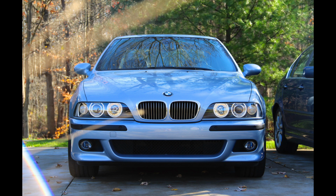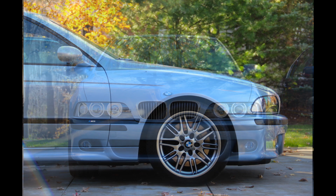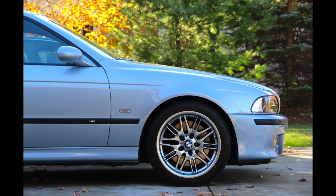He fixed the leak very quickly and went to put the transmission back in, and the pressure plate needs to be reset. The E39 M5 stock system uses a self-adjusting clutch, and the pressure plate needed to be reset. There's a specific tool for that. BMW dealers are supposed to have this tool. It's something like an $1,800 tool, so I can't go on Amazon and buy it. And none of the five or six local Ohio BMW dealers were able to get their act together enough to locate this tool. One thought they had it, but would not lend it out.